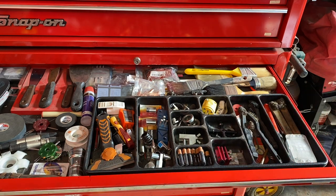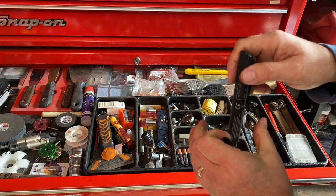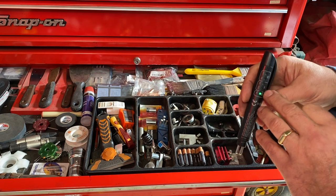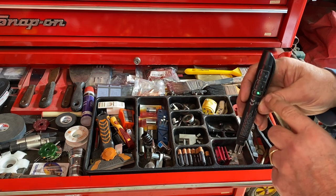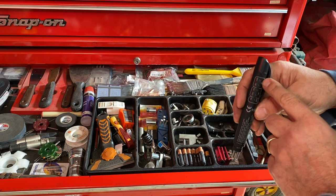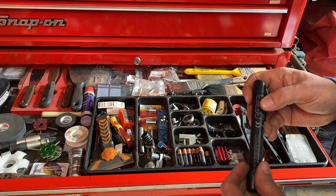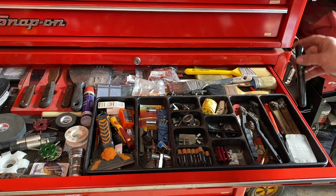For testing brake fluid — what you do is you take two prongs, put it in your reservoir of brake fluid, and press the button, and that gives you the percentage of moisture in the brake fluid. If it's nothing, it'll go green, and then if there's a lot of moisture it'll go red. So it's a very easy, quick way of dipping it in the fluid and it tells you right away how much moisture you've got, so that you know it's time to replace it. Brake fluid should be replaced every two years anyway.